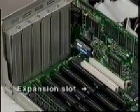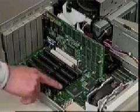If this is the first time you are looking at the inside of your computer, it may look very complicated and confusing. Just take a minute and familiarize yourself with what it looks like. And don't worry, the only area we are really concerned with is this. These are called expansion slots. They are called that because you use them to add cards that expand your computer's capability. Select an expansion slot that has two connectors in a row. This is called a 16-bit expansion slot.